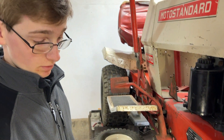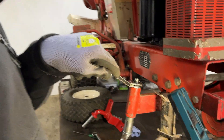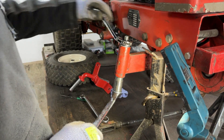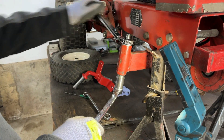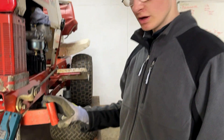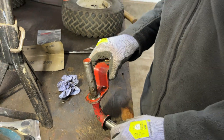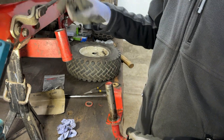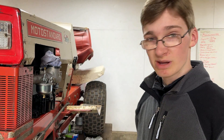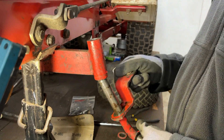On the second one now, we're just using a ratchet to try and speed up the process a little bit. We've installed the bushes on this side now too, and we've got a shim on there which really acts as a bit of a thrust washer. We've very heavily oiled this in here because with how tight a fit this is, we didn't want to grease it as all the grease would just get pushed out anyway. We did have to do a tiny bit of filing to make this fit, but it is a tight one.